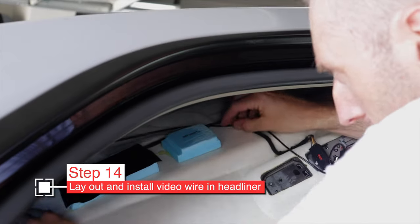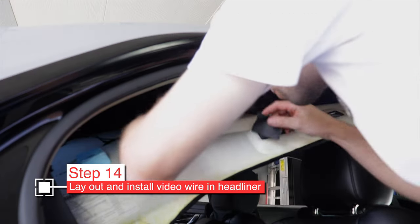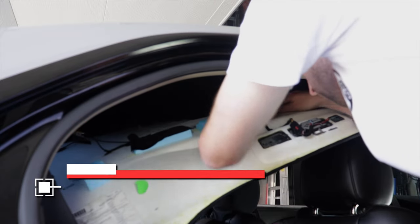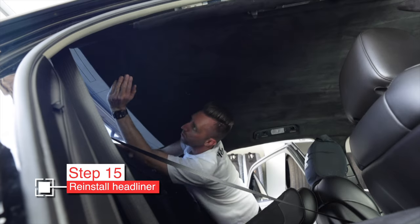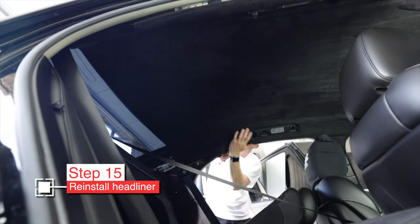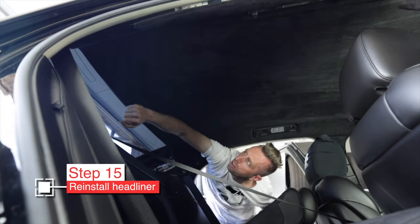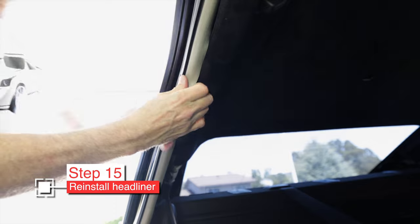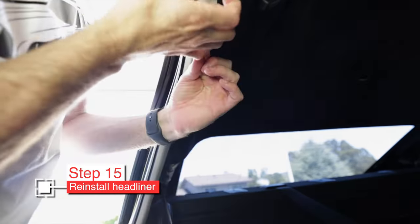Once you know it works, lay in the wires in a nice organized fashion. I'm using gaffer tape — it's like duct tape but doesn't leave a residue — to tape down the wires on top of the roof liner so they don't wiggle around or rattle. Then put the headliner back in place; make sure all the clips line up and tap them back into position. You'll have to do this a few times all around to make sure it's fully secure. By the way, Adrian's car used to be tan on the roof area and he had it recovered in a new material — looks really good.